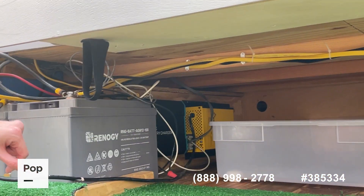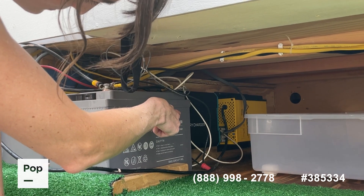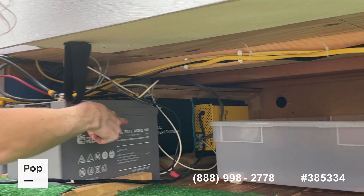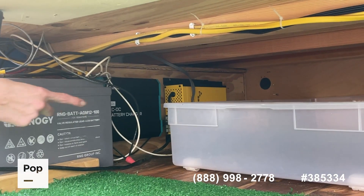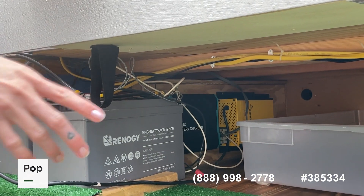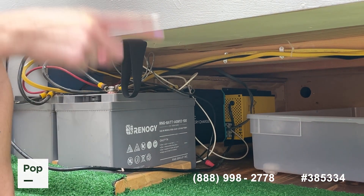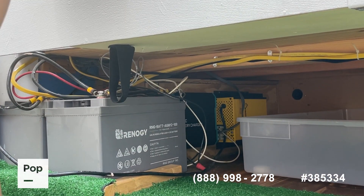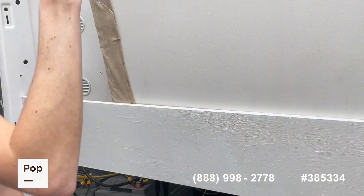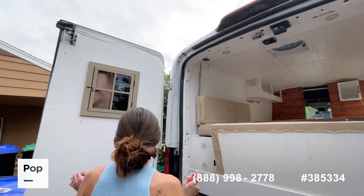These are the battery banks. We have two 100 amp-hour batteries for the house. And there's a charge backup battery charger that connects to the vehicle's engine battery as well. So when the vehicle's running, it's dually charging your house batteries. If it's cloudy outside and you're not getting any sun on the solar panels, it'll still be charging — so you'll never lose power, which is really nice.